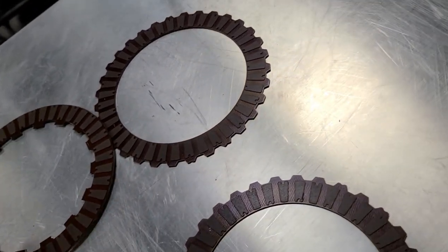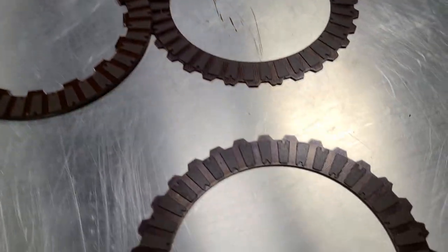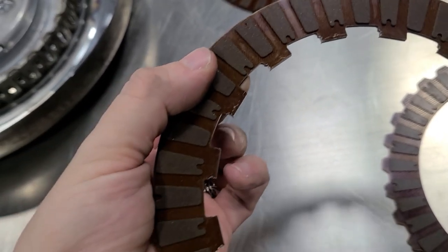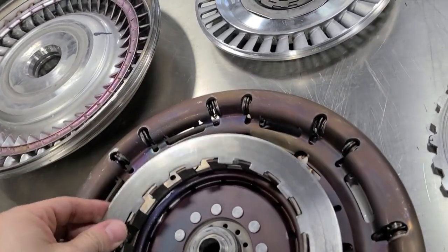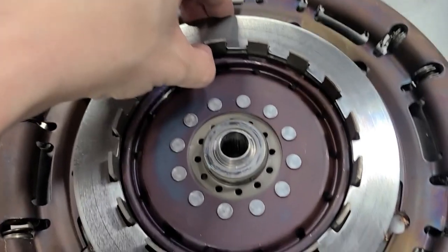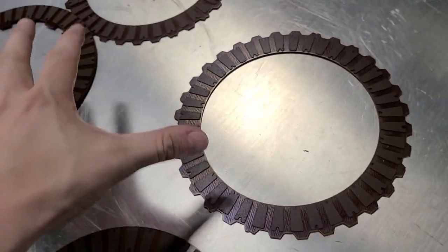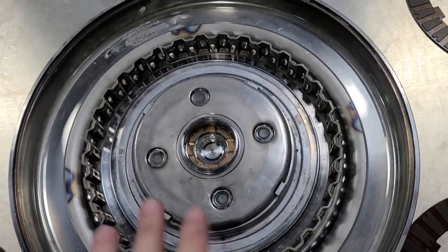This piece goes in there with lots of contact points and looks great. Where we will see some wear is on the splined surfaces — you can see on all of them it's been digging in. Those are what's flying against here, so when it's going into lockup you've got a lot of weight, pressure, and force, so eventually they get hammered in a little bit. But again, for the mileage that's really good wear — we'll pull some apart from other manufacturers that are just destroyed on a similar system.